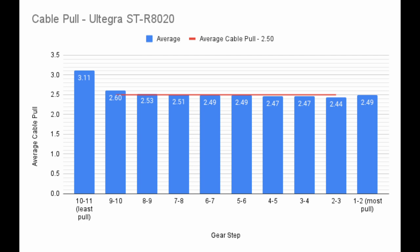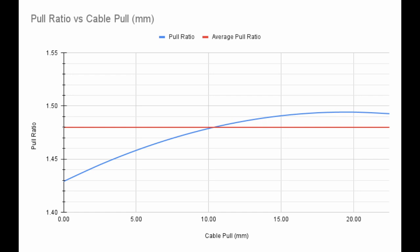You can now use this number to find other shifters that could work in place of this one. I have taken the middle 9 shifter steps and created the pull ratio curve for a derailleur that would best match an 11-speed cassette with an average cog pitch of 3.75mm. Here we see the pull ratio curve, and we can observe that it has an average pull ratio of 1.48, represented by the red line. However, a derailleur doesn't have to have a pull ratio of exactly 1.48 to be compatible with this shifter. Based on compatibility ranges from other group sets, derailleurs with a pull ratio from 1.45 to 1.51 are also likely to work with this shifter on an 11-speed cassette.